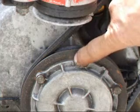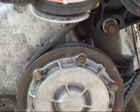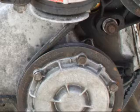Our marks on this engine are pretty easy to see. We have a mark here, a mark here, and then of course our mark on the engine itself. What I'm going to do is pinch the belt a little bit so it makes it a little easier. All right, we've got our timing marks lined up, so now we're on cylinder number one and we're going to go ahead and adjust the rest of the valves.